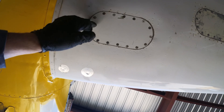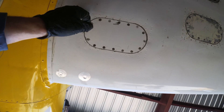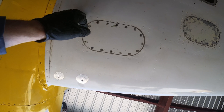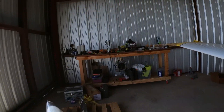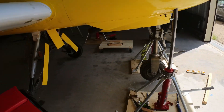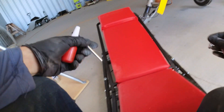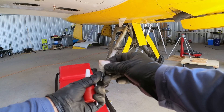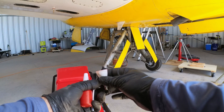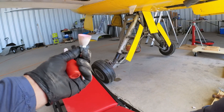I've sanded it down and I've used this technique on the other wing and it seems to have done a pretty good job. What I'm going to do is use compressed air to blow some red gasoline tank sealant into this rivet. The sealant itself is not too viscous so it does a good job of getting into those little cracks. I'm going to get a brush, apply some red sealant — you can buy this on Amazon — dab it first, then use this compressor hose adapter that I 3D-printed.